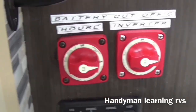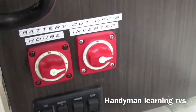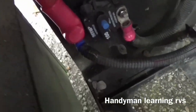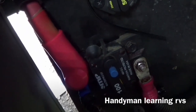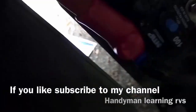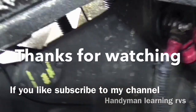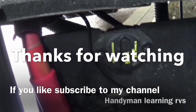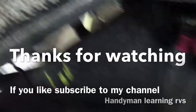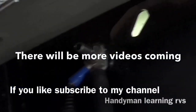Now here are the battery disconnect switches — you've got the house disconnect and the inverter disconnect. The wire from the house disconnect will come down, run through, and connect to the original 100-amp breaker. Then the other wire that was attached to the battery is also hooked up there, and that's the one that goes around to the 50-amp breaker that's right there. And the chassis ground is connected right there.